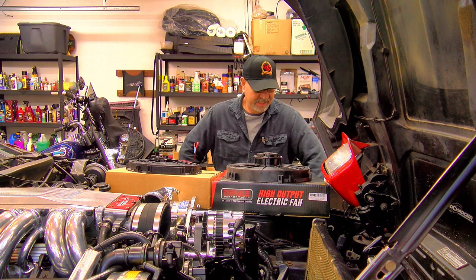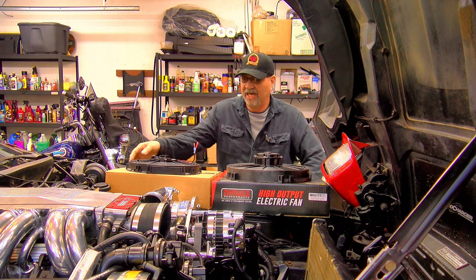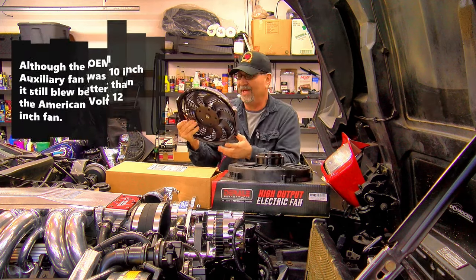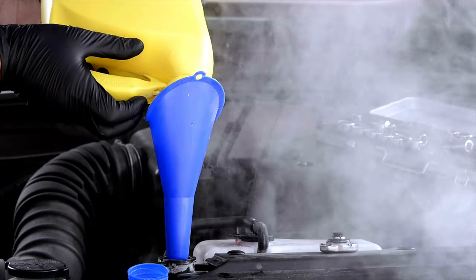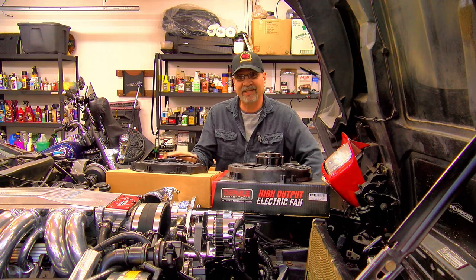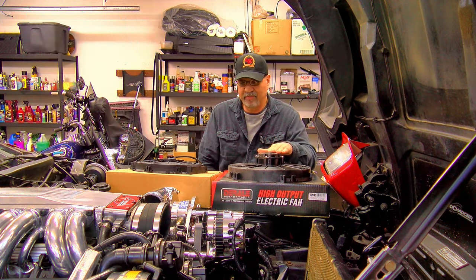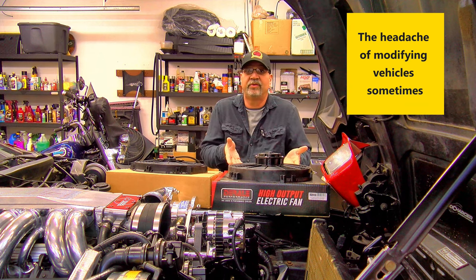So I decided to try the 13-inch fan American Volt has — that would be this one right here. You can see the difference; it will fit. But size-wise, I'm thinking this would be all right for a V6, not for a V8. I want to get as much CFMs in there as possible and I'm not going to be able to do it with this, although it is claiming 2,197 CFMs. It does kick out some decent air, but not like the bigger one. I ended up spending on both when I could have just gotten one.